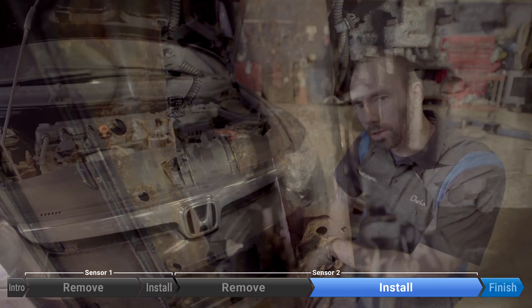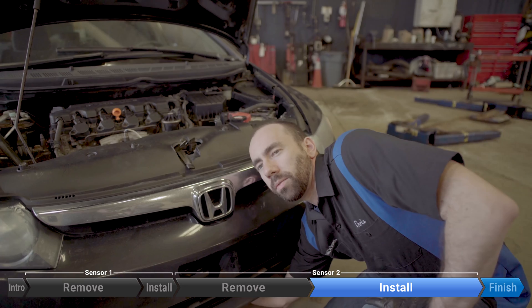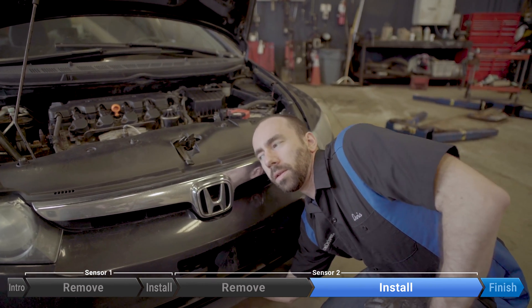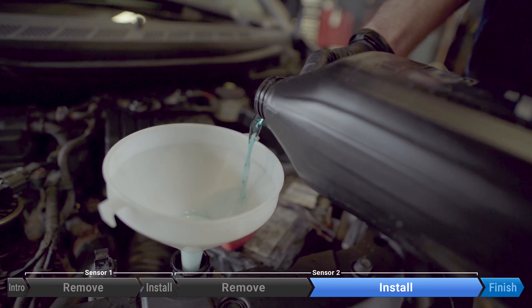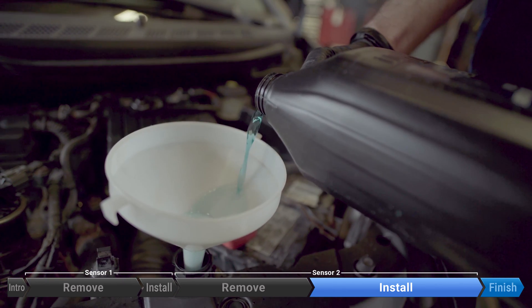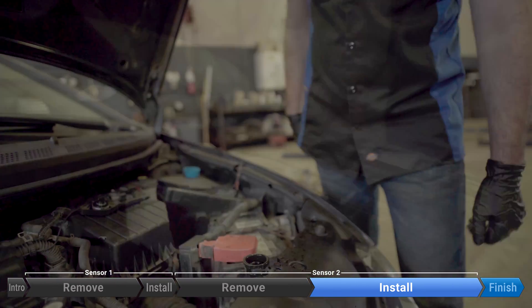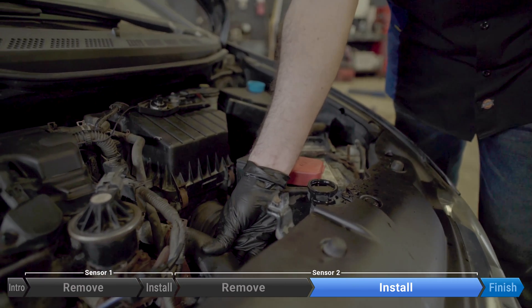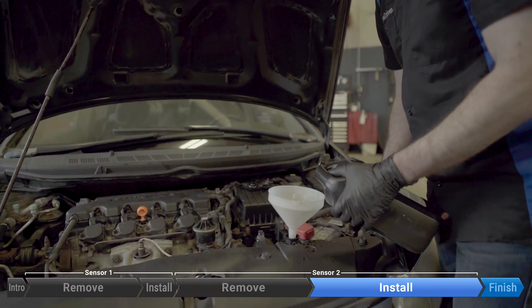Then we plug the connector back in. Now we're ready to fill up the coolant. Before we start filling, I'm just going to double check and make sure the petcock is completely closed on the radiator — there's nothing worse than hearing all your expensive brand new coolant pouring all over the floor. Depending on whether it's two- or four-door, or automatic or manual transmission, there's a different amount of coolant called for — it's all a little bit over five liters. We'll include the actual capacities in the description. So we're going to fill up to the top of the filler neck, then squeeze the radiator hoses a little bit to get out any trapped air, and then top it up again.